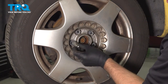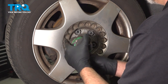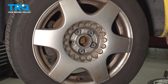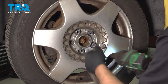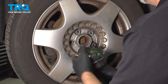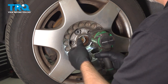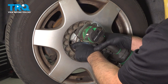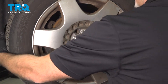Use the wheel lock key, find the wheel lock, and take that one off with a 17-millimeter socket. Then using the same 17-millimeter, we're going to take off the lug bolts. Before I take the last one off, I'm just going to support the wheel from falling. Take that off, then pull the wheel off.